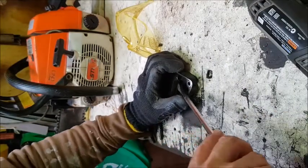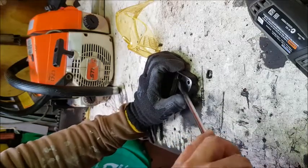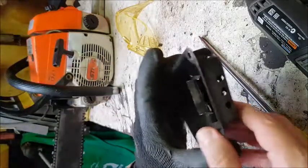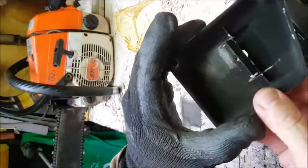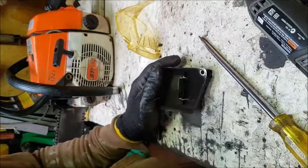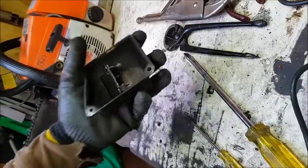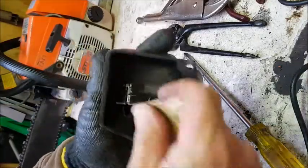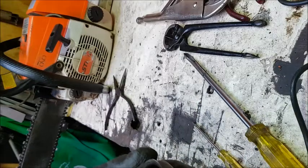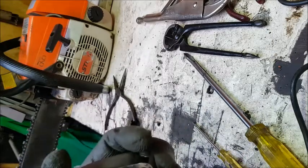No magic to this, we're just going to bend that up. You can see now we've already enlarged the size of that outlet. So there's the cuts — now just going through with a bit of sandpaper to deburr it, or a little grinder if you've got it, and make sure there's nothing that can come off in the engine.